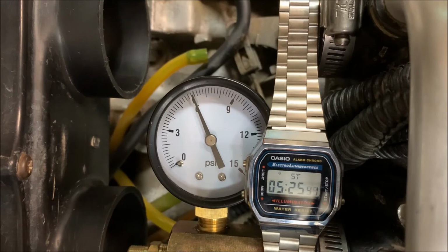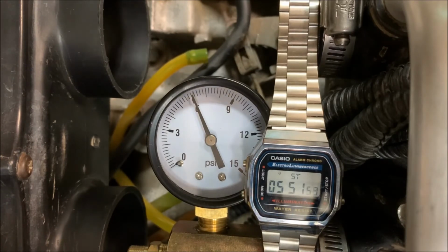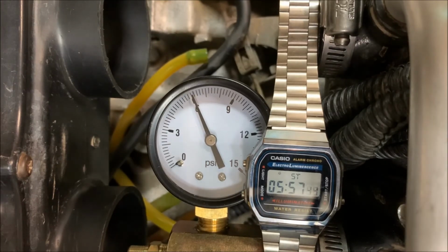Now, honestly, I'm a pretty kind of anal guy. If I'm losing a couple pounds in the 6 minute test, say 2 pounds, I'm gonna probably look for those leaks. I wanna know where it's leaking at. But we're about done with this test, guys, and this video is already gonna be long enough. So let me get my Schrader valve tool here to let this air out.